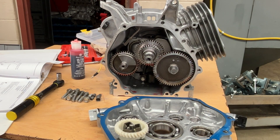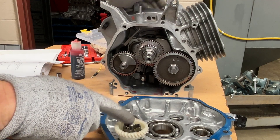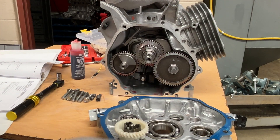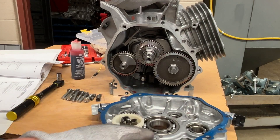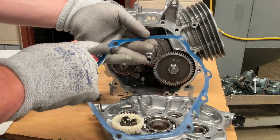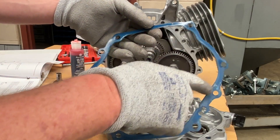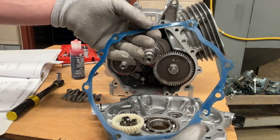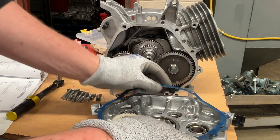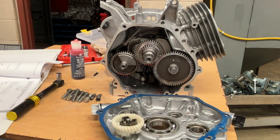Here we come to the crankcase cover. The crankcase cover has the governor gear in it. I lay the governor gear towards me because this is going to fold up like that. This is the gasket — it holds the oil. As long as you don't have any tears into any of these holes, like this one here is a little bit messed up, but as long as I don't have any tears into any holes, I am fine with that gasket.